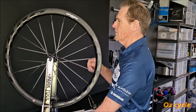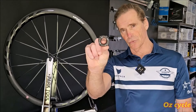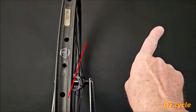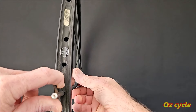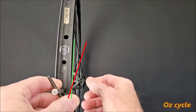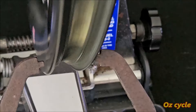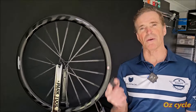To straighten the twist on the spokes, take some of the rim tape off to access the hole for the 5.5mm hex. Then you need a tool with slots to fit onto the blade of the spoke snugly, and you can turn the twist so it's straight. Using the 5.5mm hex socket on the spoke nipple and the blade spoke holder on the spoke, turning them both inwards straightens the spoke without affecting the tension. Taking the tools off, the spoke is now nicely aligned, and spinning the wheel it's still perfectly true. It only takes a couple of seconds per spoke.